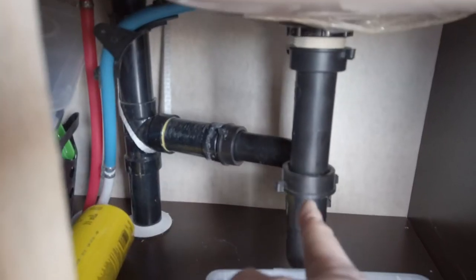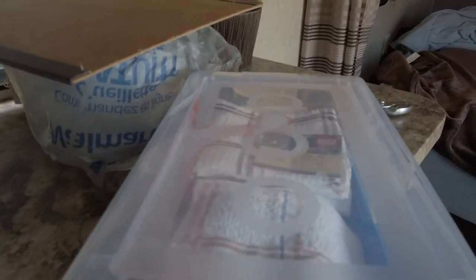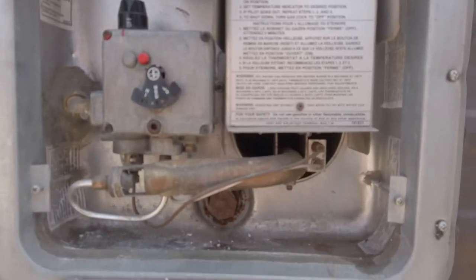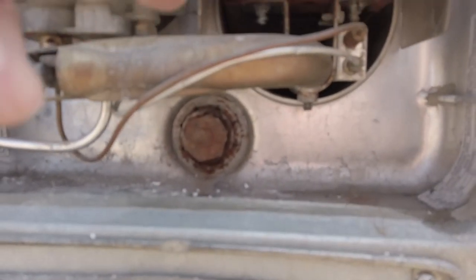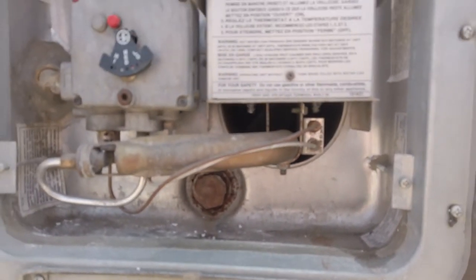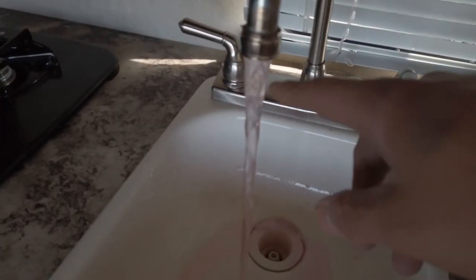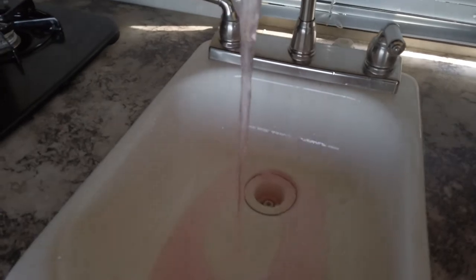This box was underneath the sink in the corner. I noticed there was some pink on it after that big negative 50 cold snap. I checked some of my connections and some are loose — good thing nothing broke or shattered. I'm checking the plug again to make sure it's not leaking. I did it up pretty tight and put some new Teflon tape. Now I'm making sure I get all the pink out of the lines and I'm filling my gray tank up so I can dump it out. That's it — I'm good to go for this camping season.